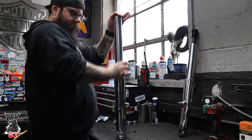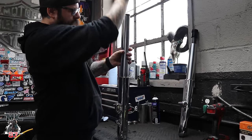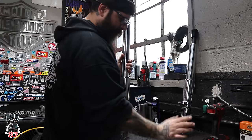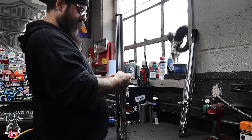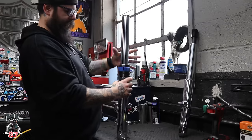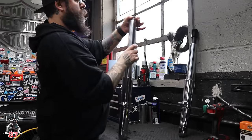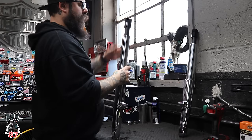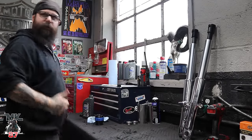That spring ran away on us — that's how they go. I was trying to put the dust seal on before. This last clip here holds everybody in place as your fork legs go up and down, keeping your seals and bushings from coming out. Then you open it up and measure the amount of oil — fill it up, close it up, and reinstall.